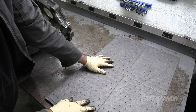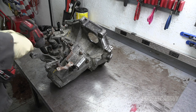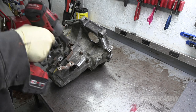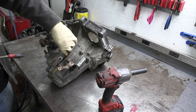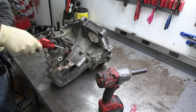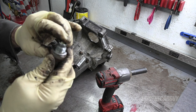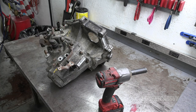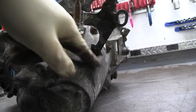I'm going to clean my work table and set up a mat so I have a place to put the internals while I work. I'll start with the 17mm fasteners on this mounting assembly and take the reverse light switch out. That takes an inch and a sixteenth. I'm trying to avoid introducing contaminants. That's the reverse light switch — it makes that clicking noise when activated. With that out of the way I have a clearer shot at the fasteners for this bracket, which are 12 millimeter.